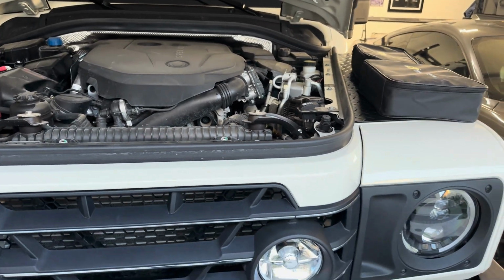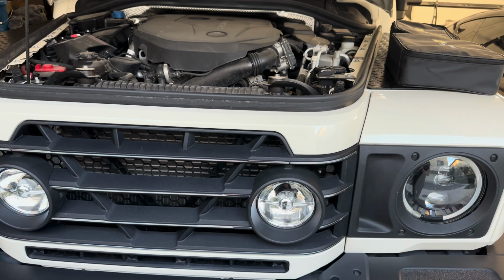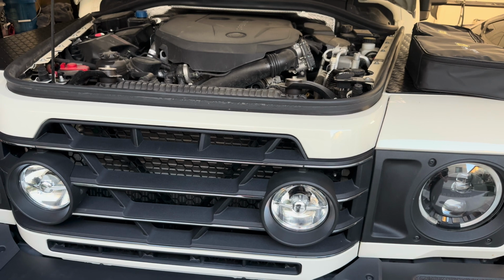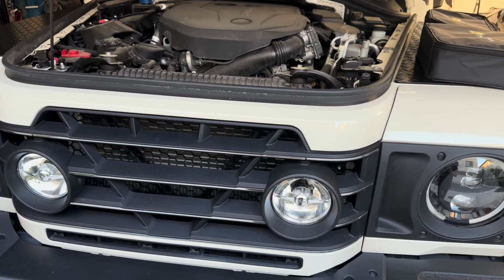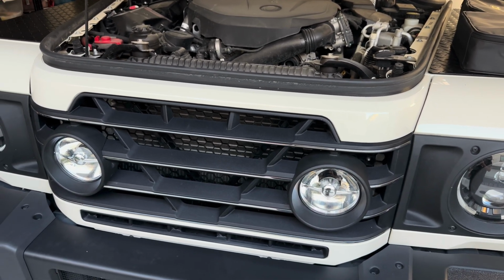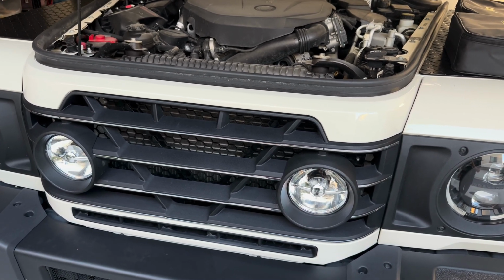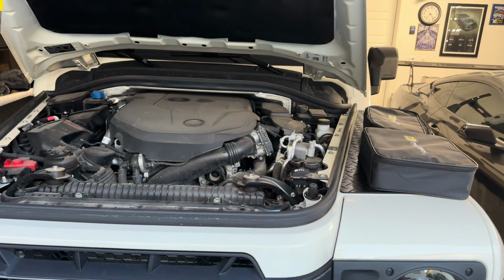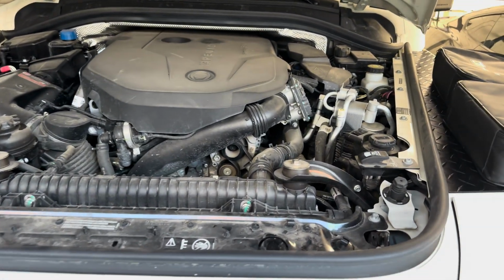That was a little frustrating at the beginning because of the lack of instructions, but I was able to figure it out. It does come with a complete harness because the wiring harness is originally designed to operate the TJM lockers, I suppose, or any other air-actuated lockers for that matter. So the harness was a bit bulky, so I had to cut that down and figure out where things are supposed to be wired. That took a little bit of time, but overall, after it was installed, super useful.